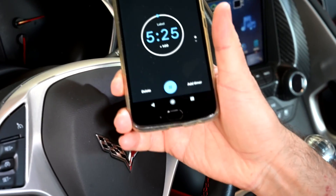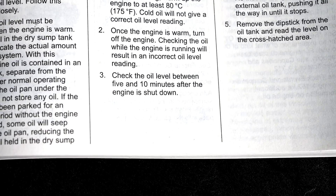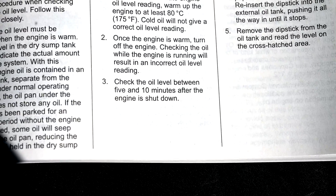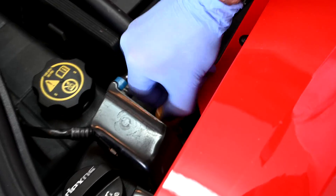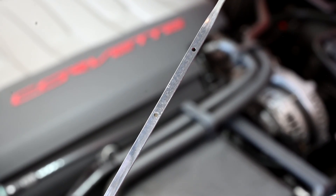The engine is off and we're starting our timer. Just as the instructions state, you have to wait between five and ten minutes after the engine is shut down. We're waiting for the timer to count down, and as soon as it hits zero we can check the oil. It's kind of like NASA waiting for the Apollo mission to come back into the atmosphere. Now that it's been five minutes, we can pull out the dipstick to get the most accurate reading. We'll wipe it off, put it back in, and pull it back out again. We can barely see it right there — yeah, we can add a little bit more.